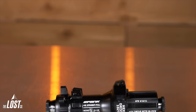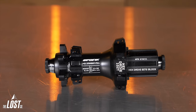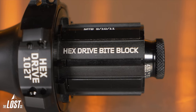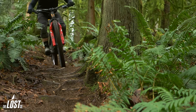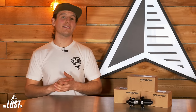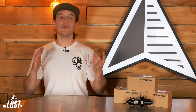Another cool feature is that the Shimano Hyperglide freehubs are made of lightweight alloy but feature anti-bite, which consists of a single steel-reinforced spline. You've most likely had that annoying occurrence when your individual cassette rings dig into your aluminum freehub splines making them stuck on there pretty tight, requiring some serious force to remove. In the past the only workaround was to run a full steel freehub body, but of course that is much heavier. Spank figured this out by using a lightweight aluminum freehub and just reinforced one spline with steel so the cassette can't rotate and dig into the other splines. This isn't much of a selling point to those running SRAM XD or Shimano Micro Spline freehubs, but if you're still running a Shimano Hyperglide freehub, you finally have a solution with a lightweight and strong freehub you can actually trust.